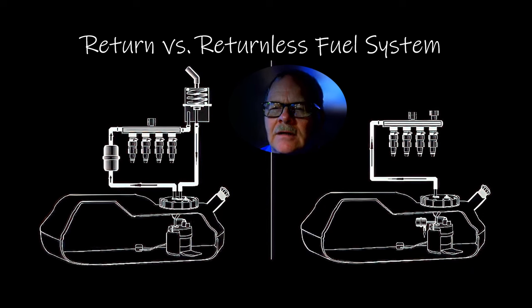Now, return versus returnless fuel systems. The fuel that comes out of the pump goes through here to the injectors. The pressure raises this spring so that the seat opens up, and fuel above 40 psi goes back to the tank. On a diesel that's got return fuel, they have to run this return underneath the fuel so it doesn't get oxidized and make tar in the fuel tank — and it will do that. Volkswagen misfired on that on some of their vehicles because they had the fuel spraying back into the tank from above, and the oxygen in the air would react with that fuel spray on the return, making tar and clogging things up. Ford Power Strokes had the return going all the way down with a little duck-bill at the bottom of the tank so it never saw any oxygen on the return side.